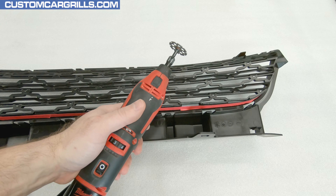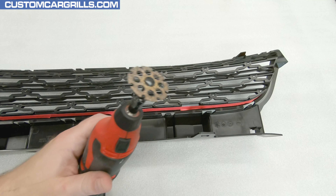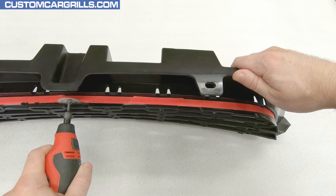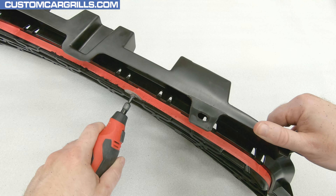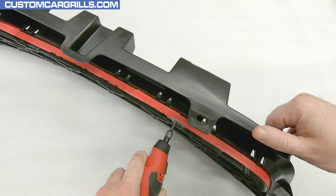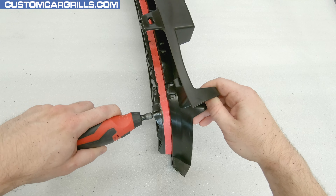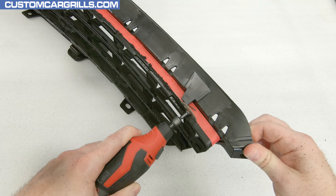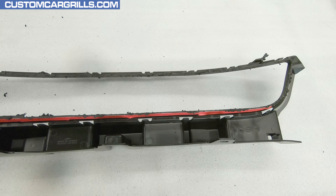To do the cutting, I'll grab my rotary tool and equip it with Dremel's number 543 cutting and shaping wheel. Then I'll carefully cut right up to the tape line. A good steady hand is really important for this step. If the installer is not used to using a cutoff wheel like this, then it can be cut further away from the tape and be shaved down little by little later on. I'm just working my way around the whole perimeter and not digging in too deep. Once the cut is made all the way around, the back of the grille should lift off like so.